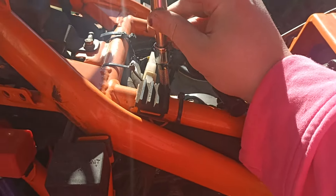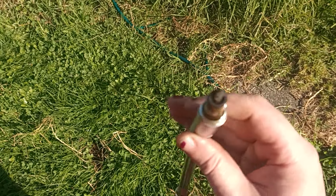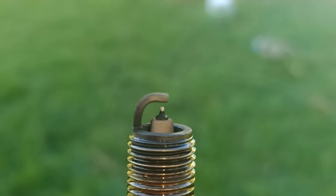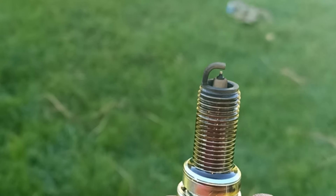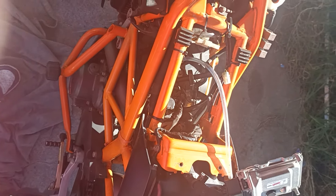It's all attached to my socket — there we go. I'll check in once that's out. That's a very healthy looking plug to be honest, and nicely gapped too. Alright, let's put the new one in and see how we go. All we're going to do is thread that down by hand. I'm going to switch off the video for this because I really need two hands — we're going to wind that in and then nip it up with the plug socket at the end.